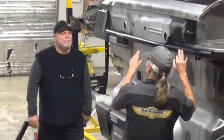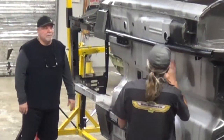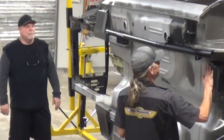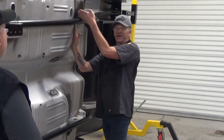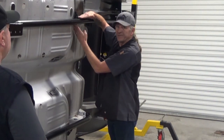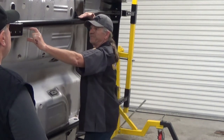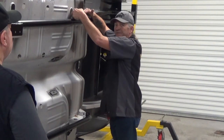Yes, they are. They cut a slot out and do like a tube through the floor, and you can see where the floor drops off and goes kind of under the seats. Well, that is where the torque box stops inside the car. And the subframe is right there on the torque box. So they slot the floor from this subframe through to that subframe on the torque box inside the car.